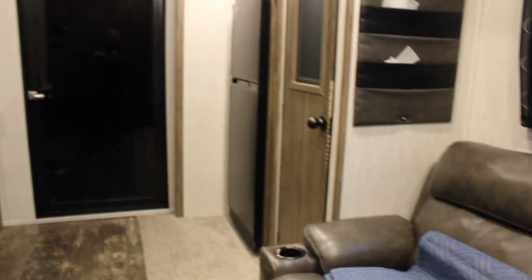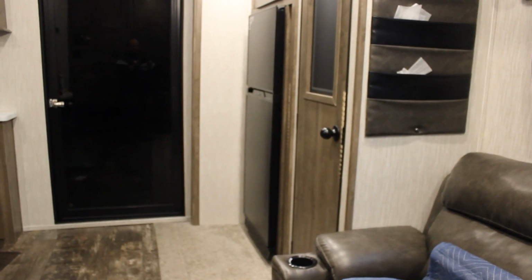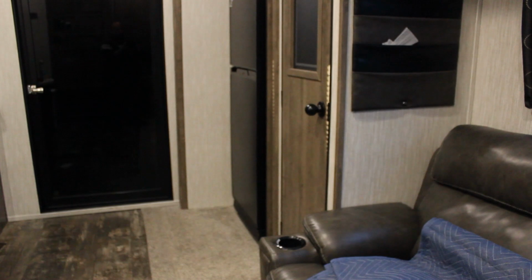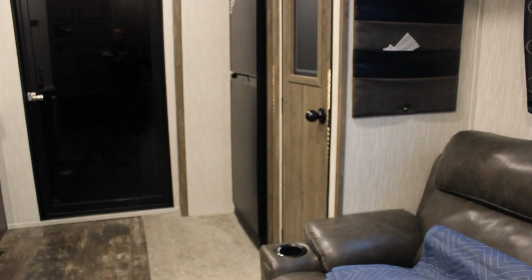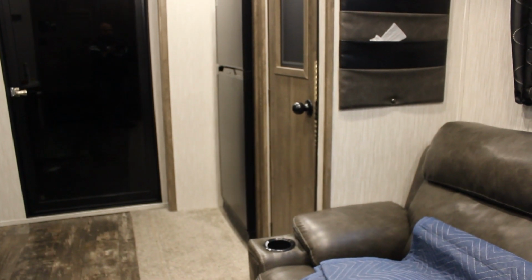The only thing I could tell you is, and you probably can't hear it on this camera, but if you guys see the dryer sheets all over, it's what I do to winterize it. If I shut this switch off right here, you'll actually hear the tone of the motor increase, like these lights are drawing too much power. Listen. Again, I don't know if you can hear that or not, but if I turn this on and off, I could definitely hear the draw in that fridge. So, at this point in time, I guess we fixed it.